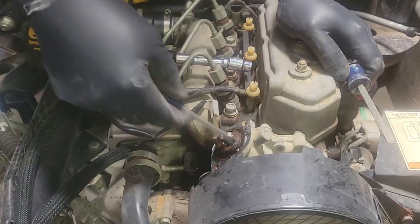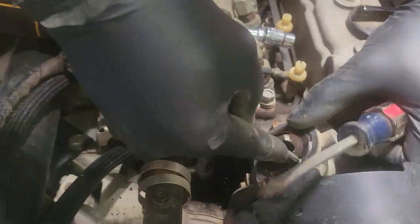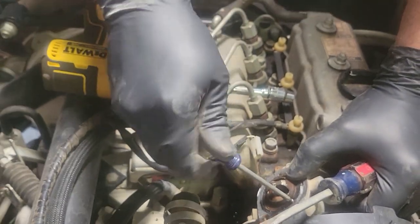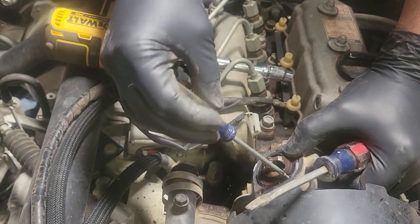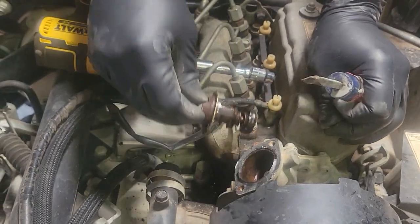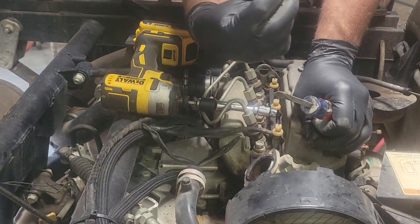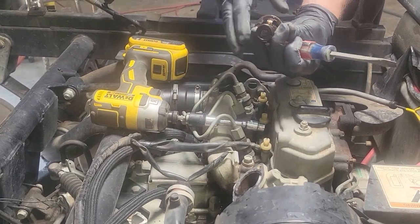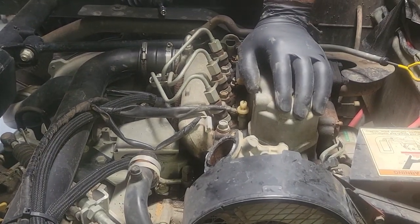There's a little screw right here holding this thermostat in. Mine did not have that, so that's kind of strange. So don't forget to pull that screw out. Yeah, that came out much easier. Kind of nasty. Mine actually had compromised and mine was bent, like an elbow, so I know that it was stuck. All right, so we're gonna pursue removing the head.